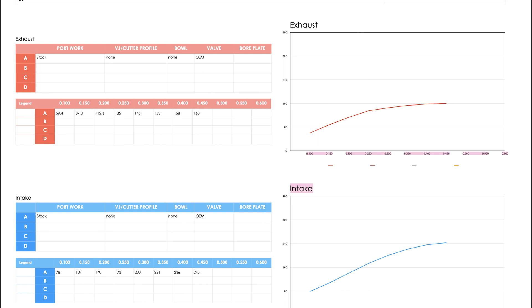What we have here is a pretty good looking cylinder head on the flow bench. I reckon that more people put a big-ass valve and try to put all that lift in the cam, and the head's just not doing anything. On the exhaust side, we got a pretty good flowing head — from the crack of the valve up to the biggest cam you can stick in there, which is about 453 lift. So it's like 160 on the top end, but it's like 145 in the middle. I like to see 300 to 350 lift — it's all looking good.